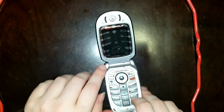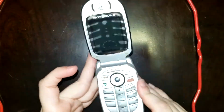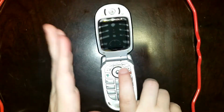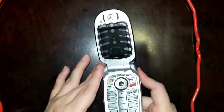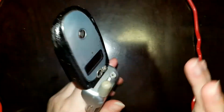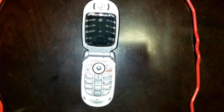The first thing you're going to want to do is figure out how to disassemble the device, or at least remove the affected parts of the housing. Now, I've worked on this phone before, or a similar model, and these 4 little rubber feet conceal some screws that we will need to take this front panel off. Because the method that I'm going to use involves a liquid, and you do not want to submerge an electronic device in liquid. Now, let's see if I can remove those feet.